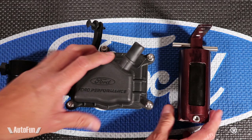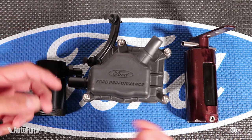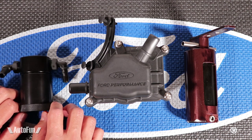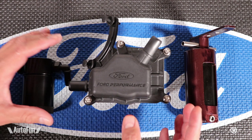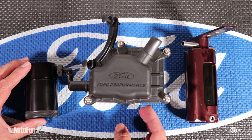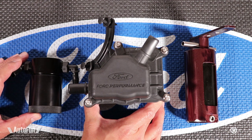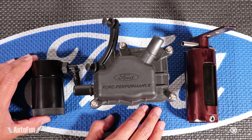So why do you want an oil separator? Very briefly, if you don't know what an oil separator is, don't worry — a lot of people are in the same boat. Your engine sucks in a lot of ventilation through different ports, and some of those ports can potentially suck in oil from the same engine. That is called blow-by, and it's a normal situation on most motors — and you'll have more of it as the motor gets older. That oil will eventually contaminate passages, intakes, and valves, and can affect the performance and power delivery of the car. So separating the oil and keeping it away from those passages is something you want to do.